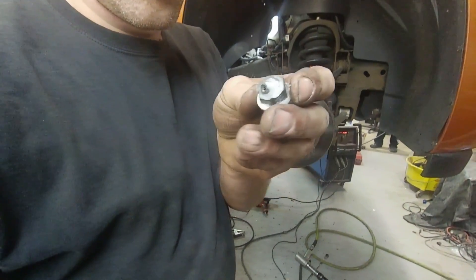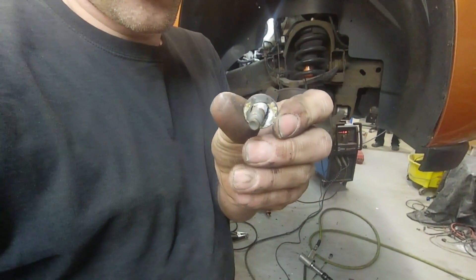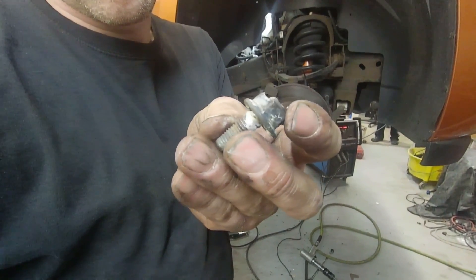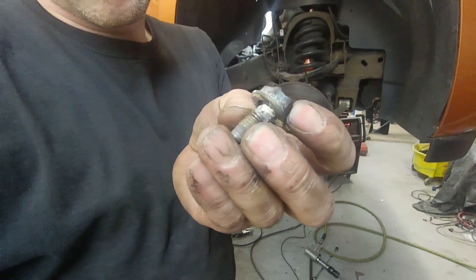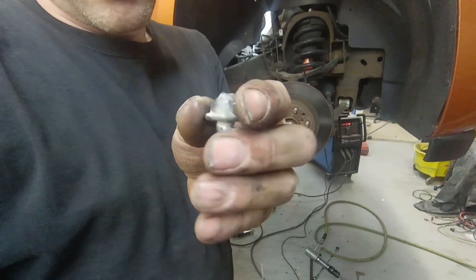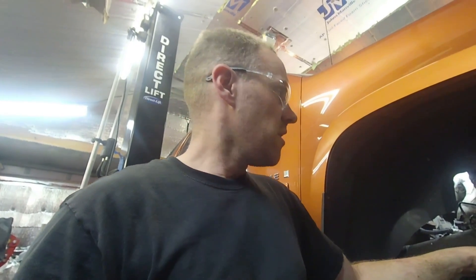Here is the bolt after I got it out — you can see the weld on top, and where the aluminum threads got chewed up a little. The weld did push out against the head a little bit, so the first part of the head's threads are damaged, but the rest are fine — it'll still be perfectly fine to put a bolt in there. So now you have two ways to remove broken studs: the spline drive ratchet method when the stud is protruding, and the weld-nub-and-nut method when it's broken below flush.